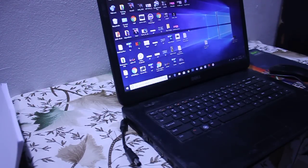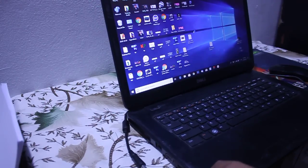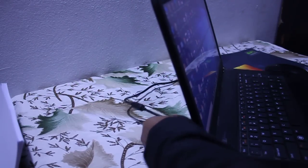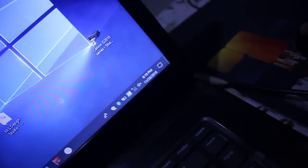The laptop has been successfully turned on. In this case, if your laptop does not turn on, maybe your battery is damaged, so replace your battery. The laptop is turned on — that means the battery is not dead — so I am plugging the charger again. Now as you can see the charger indicator is on. On the battery status you can see the battery is charging.